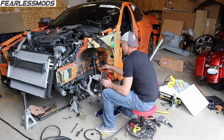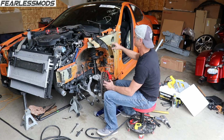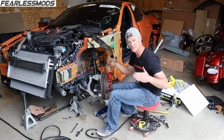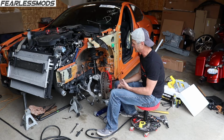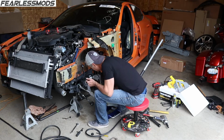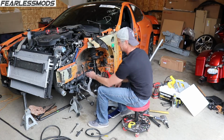That is now held up there, so that's good. I put the nuts on and I double checked that the arrows on the cap are pointing towards the front of the car, front center of the car. Verified the other side that that's the same way they're going, just to make sure we hadn't messed anything up, and it looks good to go. So let's see if we can get some of this suspension on here and then start putting things back together.